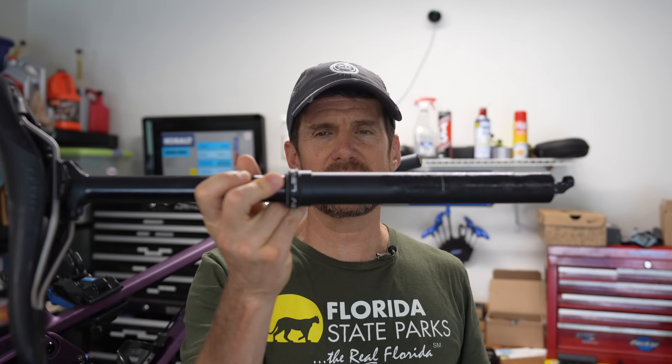I would have been done by now except the KS seat post did not come with a lever. Sure enough, the website says 'lever not included,' so I ordered it without one — the lever arrives tomorrow. Also, I thought the rear brake was a post mount for a 180 rotor, but it's actually a 160, so I need to get a riser block. We'll talk about all that.